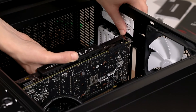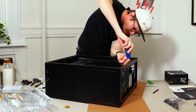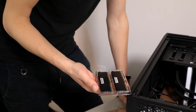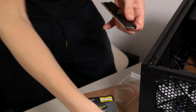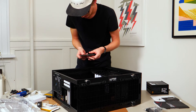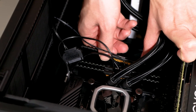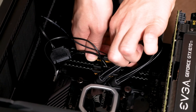The video card just gets pushed down into the PCIe slot and you screw it in, likely with a thumb screw or a regular screw. Now if there's one component you're familiar with installing, it's probably RAM — I think almost all of us have installed RAM at some point. I'm using four sticks of RAM, all the same size, brand, and speed, which means I can put them into any slot. If you're using a mix of different RAM types or not filling up all your slots, there will be specific slots on your motherboard that you need to fill up first and there's an order to them — so check your motherboard manual. You can lose a lot of performance by not installing RAM into the proper slots. Open the tabs, pop them in one at a time with some pressure from the top, and the lock on each end will click into place.